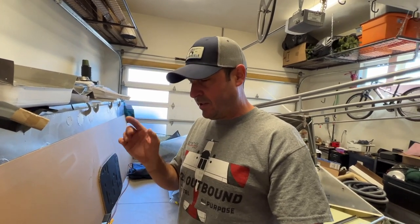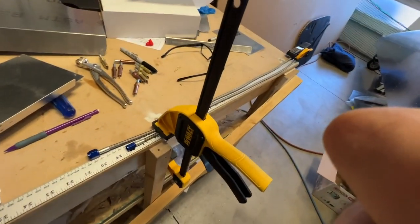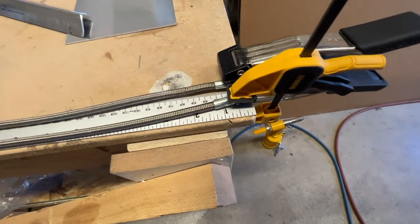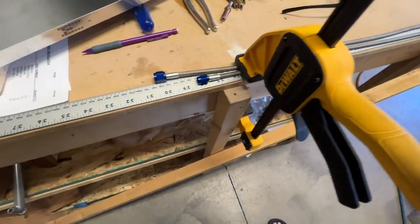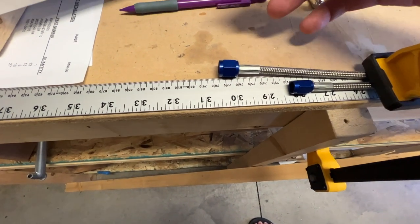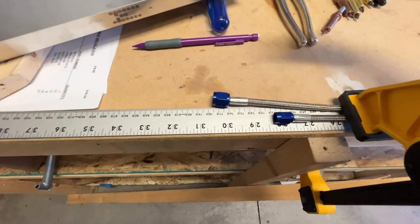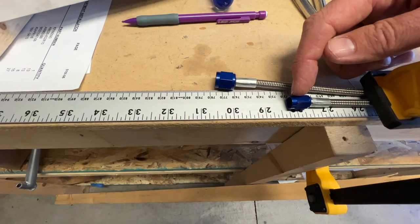The next piece of confusion: I have 30-inch lines, so I took off an inch and a half and ordered 28.5-inch lines — but suddenly they didn't fit by a lot. I decided to measure both lines to find the discrepancy. With both fittings lined up to zero on a 40-inch yardstick, this line actually measures 30 and a half inches. It's clear this new line is quite a bit shorter than an inch and a half less than the original. If the original is a 30-inch line, this is definitely not a 28.5-inch line.